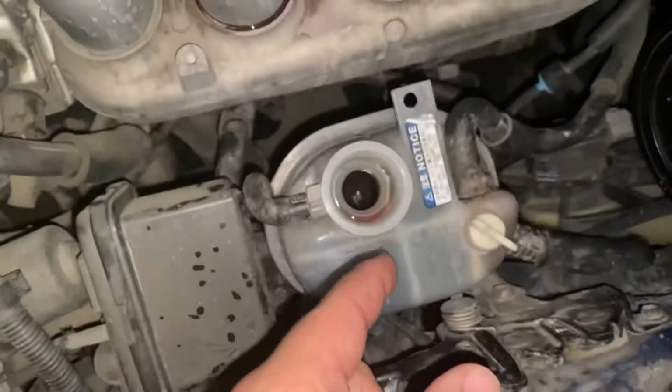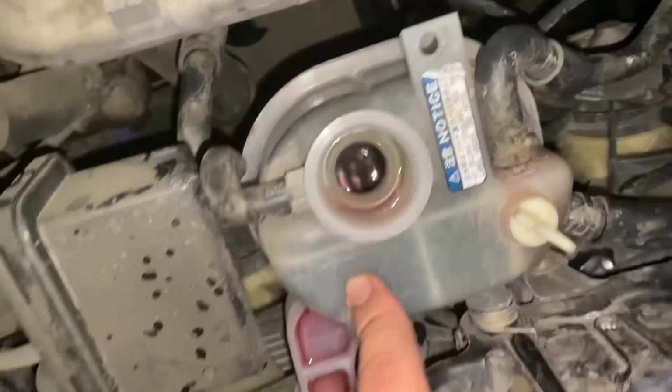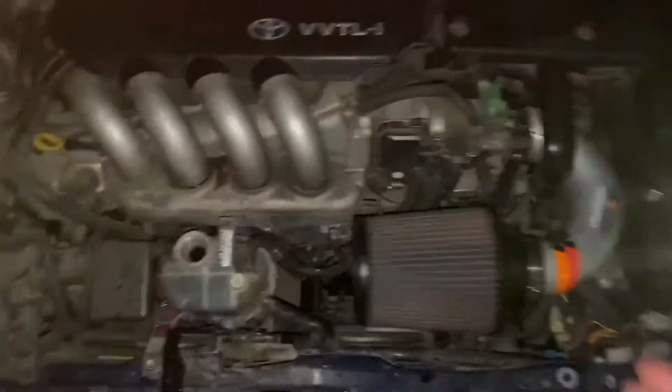So I went to go refill, and the temperature stayed the same. I took my gallon of water with me, and obviously I drove with the cap on, but I took it off, and it hasn't gone down much, so that's good. And the rest will bleed as you drive. So in a couple of days while you're driving, just carry the gallon of water with you in case. But most of the air is already burped out. You should be good.